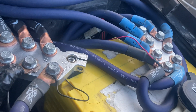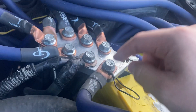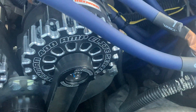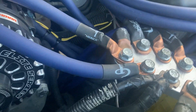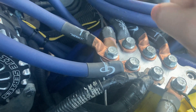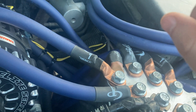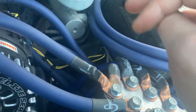I switched that lead acid out — took the lead acid out — that helped a little bit, not too much. So we got three grounds coming to the core support here, and two grounds going all the way down to the frame of the truck for this up front battery. Then one ground going back to the rear battery off of this battery, and the rear battery is grounded to the body in the back as well — two grounds to the body in the back.